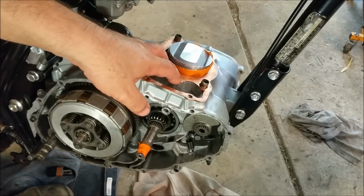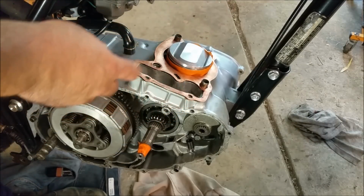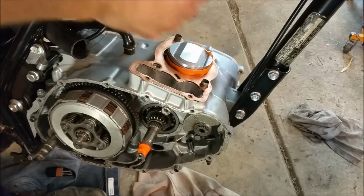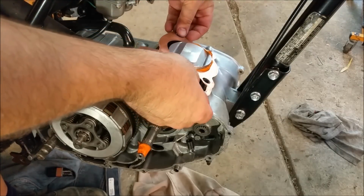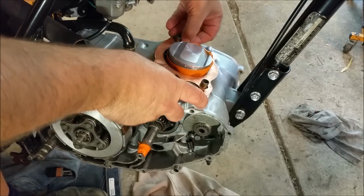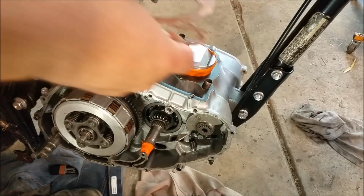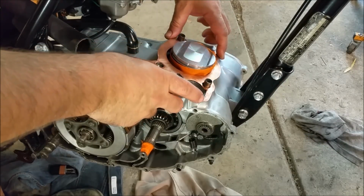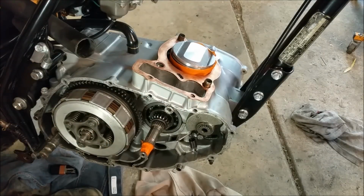So the oil can travel up there. I might even elongate that a little bit. And then we have another gasket over the top, in which case that part of it is redundant because it's already traveling up and then over and through there. So I'm just going to modify this a little bit, just allow a little bit more clearance there. So I'll try that. Oops, that goes that way. And that's fine, that's going to be good. So then we can stick this on.